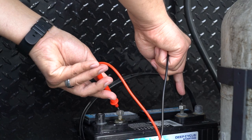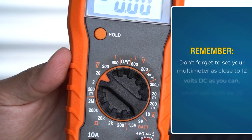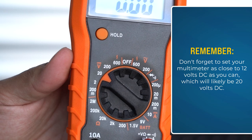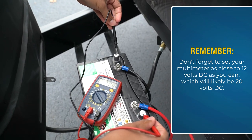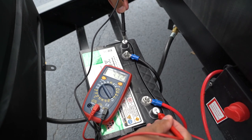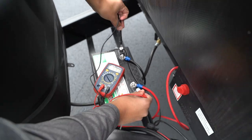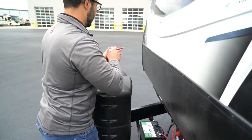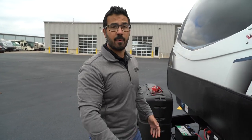What you're going to want to do is set your multimeter to as close as you can to 12 volts DC — most multimeters it'll be at 20, which is as close as we can get. You'll simply put the leads right here on your battery posts. What you should see is a reading above 12.8 volts, which means you're getting a charge coming in. And that's exactly what should be happening.